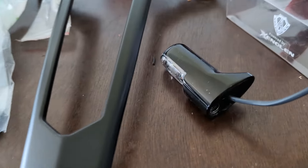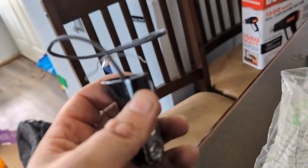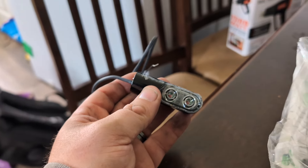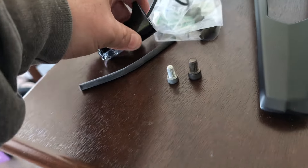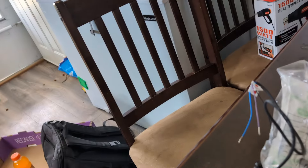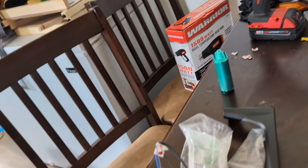Okay guys, here's the issue. Witch Doctors is kind of wrong in their description of these lights. Obviously these are for a Harley-Davidson. I'm sure the direct bolt-ons they used to make for the Victory would work no problem, but here's the issue with the Harley version. When you look at the stock lights, those were held on with these itty-bitty little things. The new one comes with a stud — a long stud and a nut.